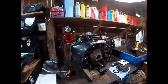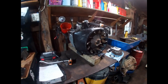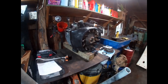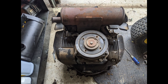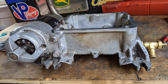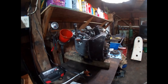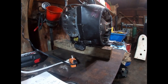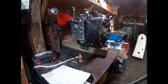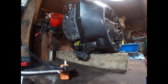There are a couple of different things you can do to fix that problem. Some ambitious guys have aluminum welded the starter mounting bosses back onto the bottom of the block, but in my opinion it's just a crappy design. What I like to do is upgrade the oil pan and starter. The reason you have to upgrade the oil pan as well is because on the B-series engines, the starter attaches to the oil pan itself instead of the underside of the block — it attaches to the front of the oil pan with two bolts torqued to 25 foot-pounds each.